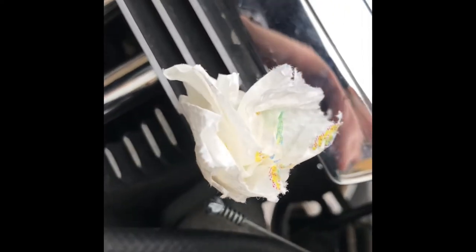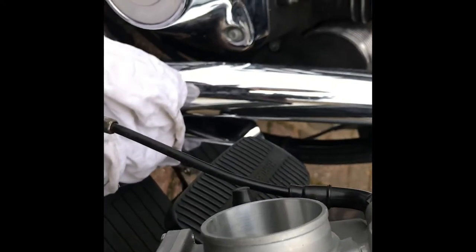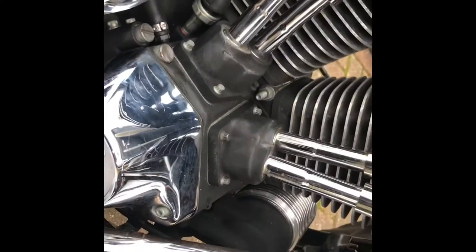There's a rubber O-ring in the adapter plate which simply fits over the top of the carburetor. So now it's a question of putting this on the bike, connecting up the cables, push fitting into the intake manifold — the rubber is on that side — so that will be the next stage. It says it's a tight fit. There's a short rubber washer, and it says to use a bit of grease on there. So it's a straight push fit on the carburetor. Let's run a little bit of grease around there so it's slippery and see how we get on.